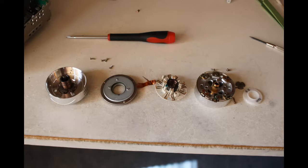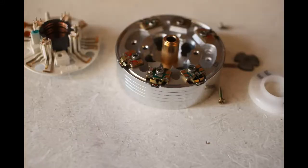The third item you can see on the screen - and this is the awkward bit for me - is the second part of the transformer mechanism. Here's a close-up of the actual heads on the head drum. You can see the metal pads on the bottom of each of the heads and they make contact with the little spring terminals on this transformer mechanism. That connects the individual heads up to all those transformer coils, and that then sits on top of the fixed coils we saw earlier and spins round. This piece spins round with the actual heads so the heads are always connected to the coils, and those coils then spin around the other coils.